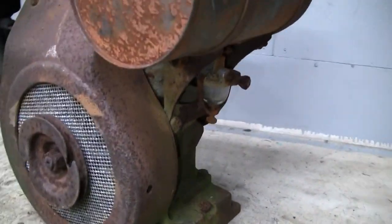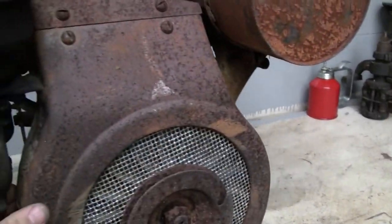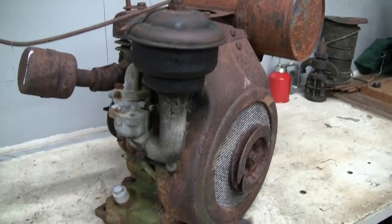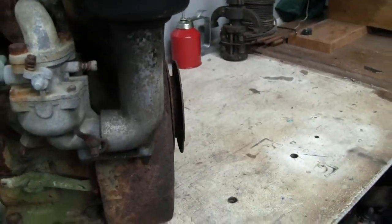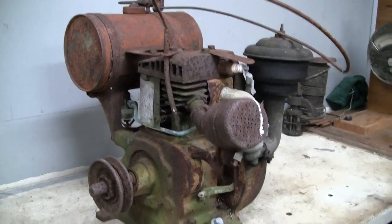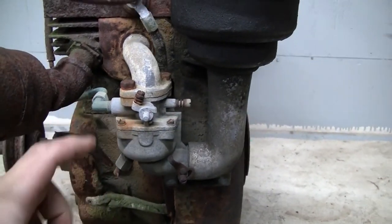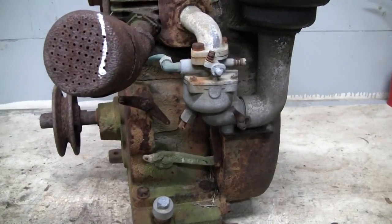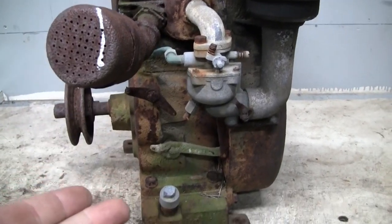Yeah, so a 15-year production run. This particular one was built in 47. So it is 74 years old at this point in 2021. And they made so many variations of this engine. I mean, there were some updates over the years. The earlier engines had a different style carburetor. Most of them had an oil pump. This engine does not have an oil pump. I think this is the first year that they did not have an oil pump. I mean, this is pretty late in production.